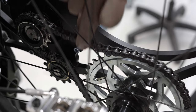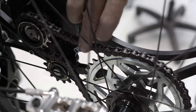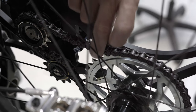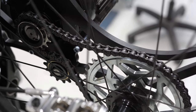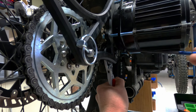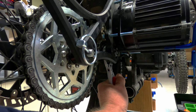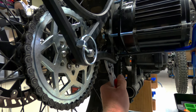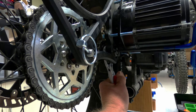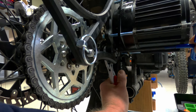That's also evident just raising the chain up and down. It'll be noisy riding the bike — every time you accelerate it's going to have to pull that tension out. So what we do here is from the inside hold it with the flat, and then with the 5mm we loosen off the bolt. You can see here we have the movement of the idler. We're going to push that up as we tighten that bolt up again and get it nice and snug.